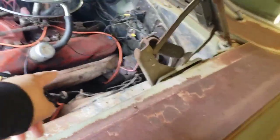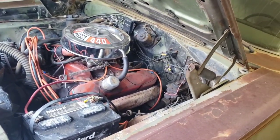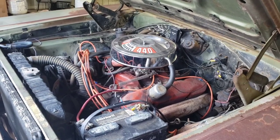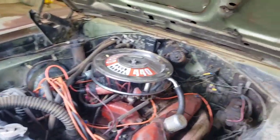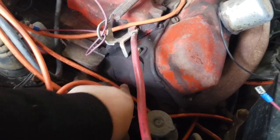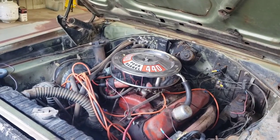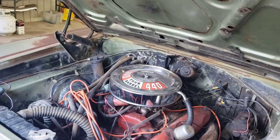It has the HP manifolds on it. Somebody went through and painted it orange — in 68, they did not paint engines orange; they didn't do that until 69. So if you have a 68 engine and it's painted orange, somebody did that — that's not factory. You can see down to the heads it is orange. So somebody has been through this engine at one time or another, and I'm not sure if anything's truly been rebuilt or if it was just taken out of something, cleaned, spray-painted, and that was it.